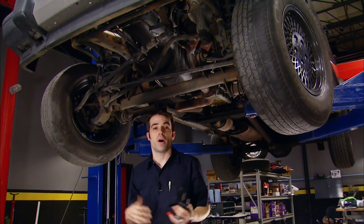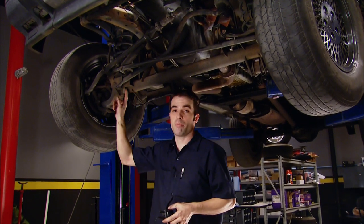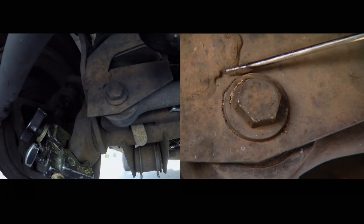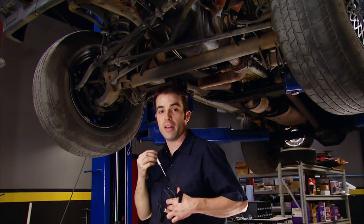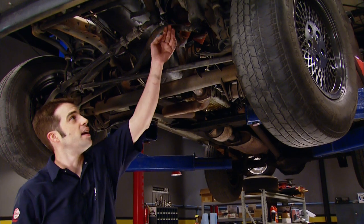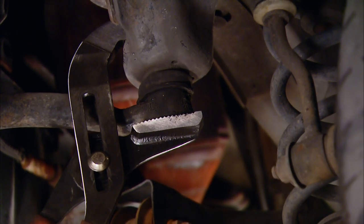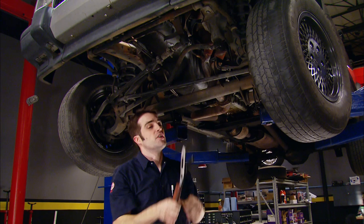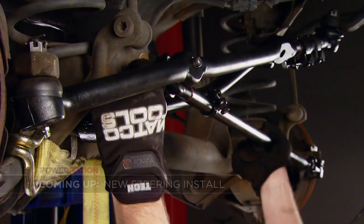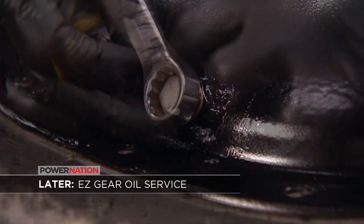After a quick test drive, it was pretty clear that the majority of the noise we were hearing was coming from the area near the number two transmitter, which was right at the base of the track bar mount. The video confirmed that this track bar was moving around a little bit, and if you look really close you can see some shiny metal where even the bolt was moving around. Now you would think we could fix that just by tightening up the track bar bolt, but I've also picked up a little bit of play in the tie rod end at the frame end of the track bar — no side to side play, but enough up and down play to definitely need replacement. We're going to get some new front end parts ordered and get this thing fixed up. After the break we'll install our new steering linkage and later modify the diff cover to make gear oil changes easy.